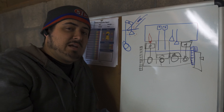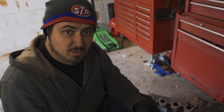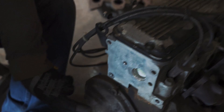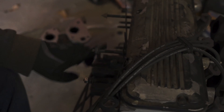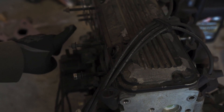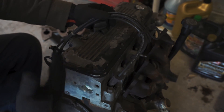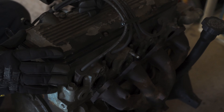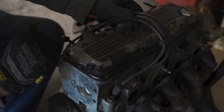Let's get back to the engine and show you the actual internal parts now that you understand my very crappily drawn engine. Going back to our drawing and applying it to this — the camshaft is inside here, timing-driven from the crankshaft. This is the timing cover; the camshaft runs along the back of the engine and pushes on push rods that open the valves you just saw. Now I'm going to take out these spark plugs and take this off so you can actually see the valves, and I'll go ahead and move them again to show you how they're supposed to work. We could find broken stuff under here — didn't take this engine apart before.